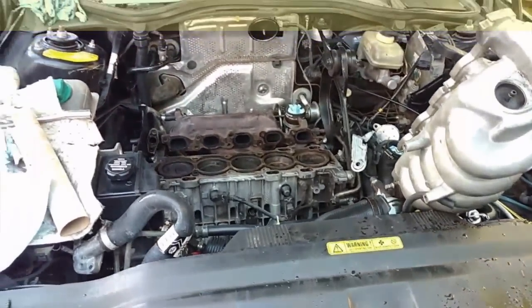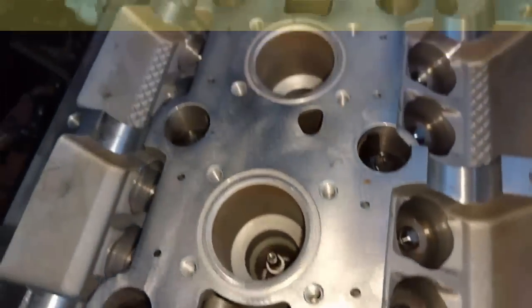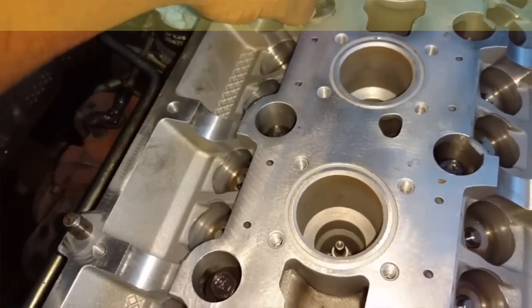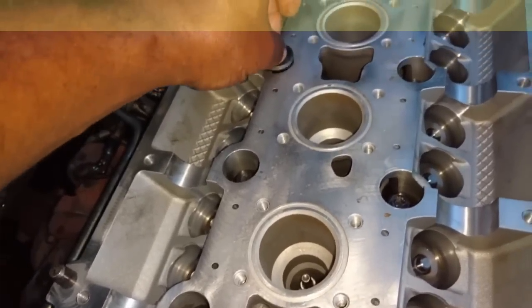So we're cleaning it up to put it back together. I'm having issues with head bolts fitting in their holes — this MTC brand, acquired from IPD. As you can see, the bolts fall down into the head, but this one I've tried on all the holes and it just won't fit. So I'm going to take a metal file and file a little bit of it off, but I'm going to try to work with IPD and get that resolved.